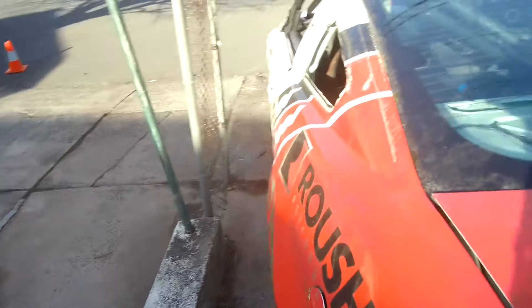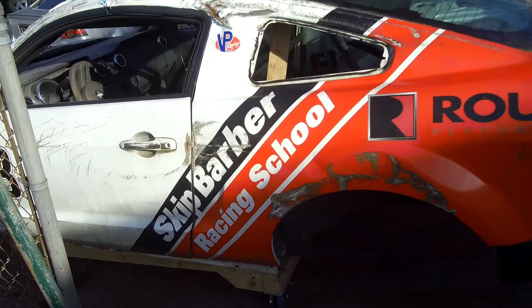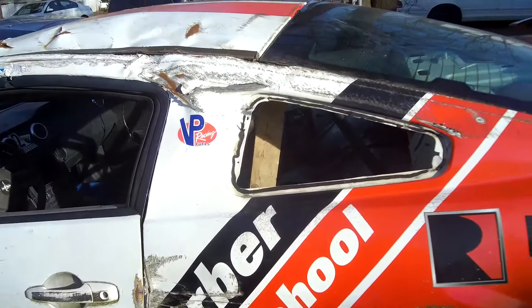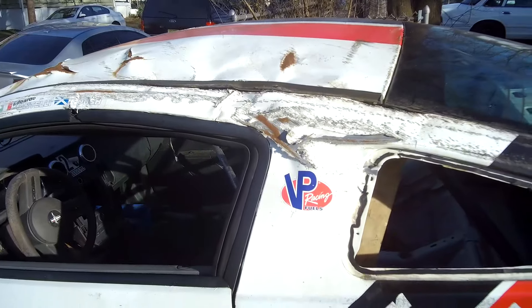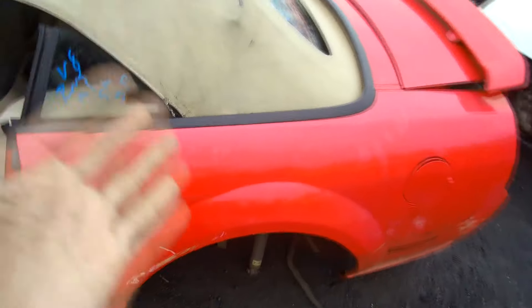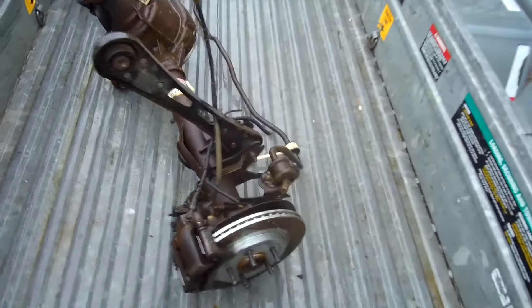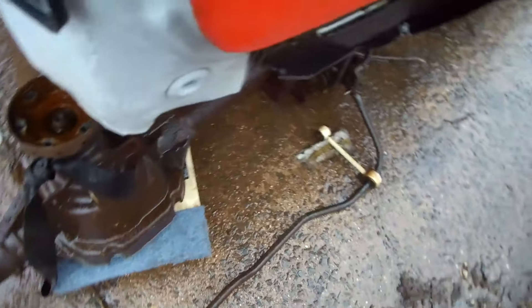Let's switch gears for a bit and talk about this engine. If you checked the community tab, you saw a video where my son and nephew went to the junkyard to pick this engine up. Something happened — look at it — I think it hydro-locked, because you can see the bend. It probably filled up with gas or something and ignited. But the wall isn't scarred up or anything — it's still doable and workable. Heads are over here, cathedral style.